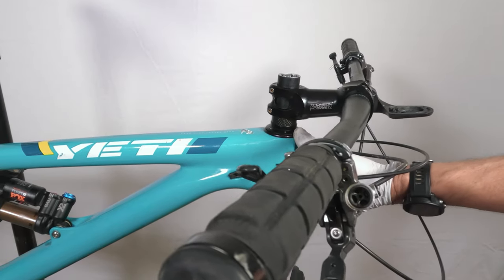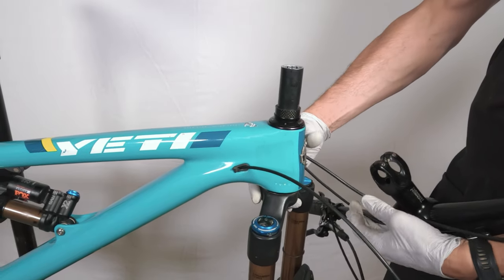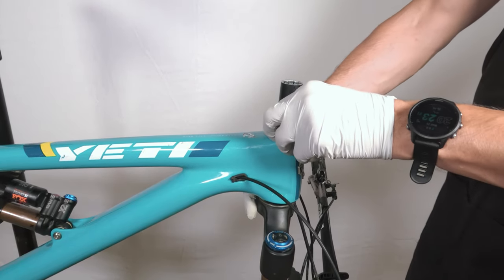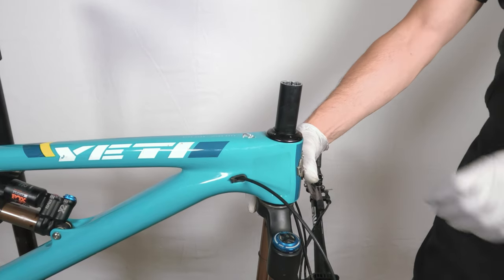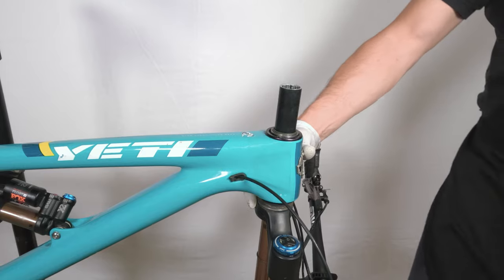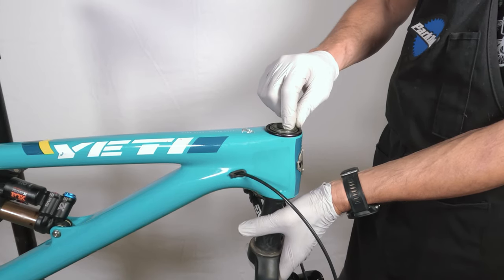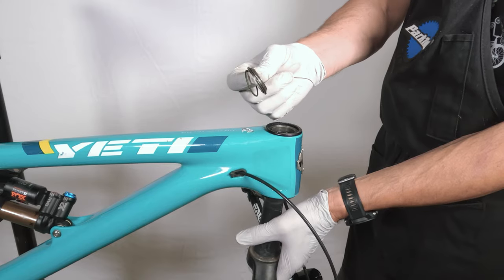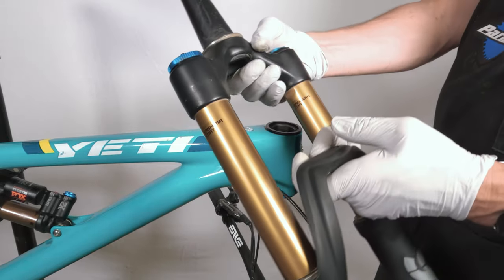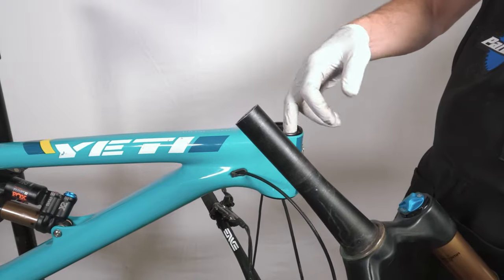We're going to take the spacers and put them on the side with the bolt. Take the handlebar — always hold on to the fork — and just let it hang, flip over and hang. Now I've got more spacers over here at the bottom; I'm going to take those and put them aside. Now we have the headset cap — I'm going to take out the headset cap and put it on the side. Put everything in order so you remember where it's at. In this case I have a rubber ring with the bearing inside, so I'm going to take this and put it on the side. And there is my fork.